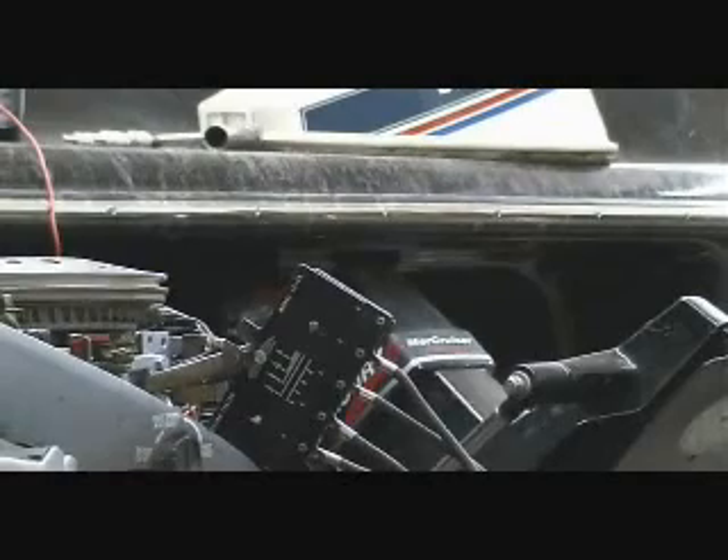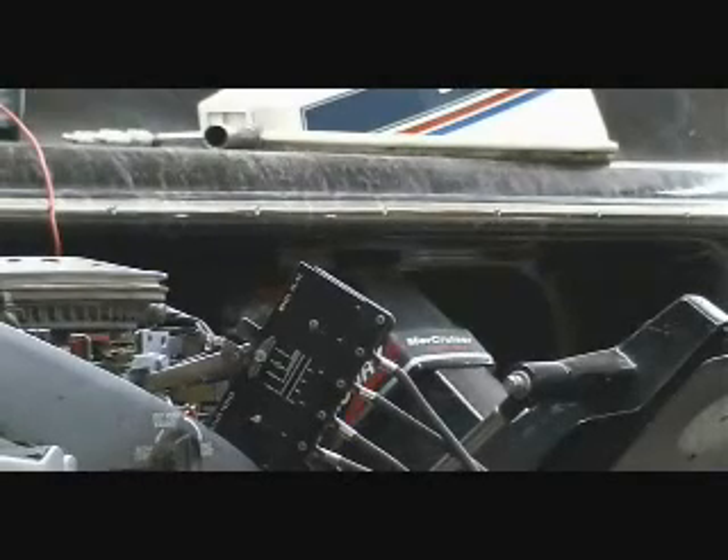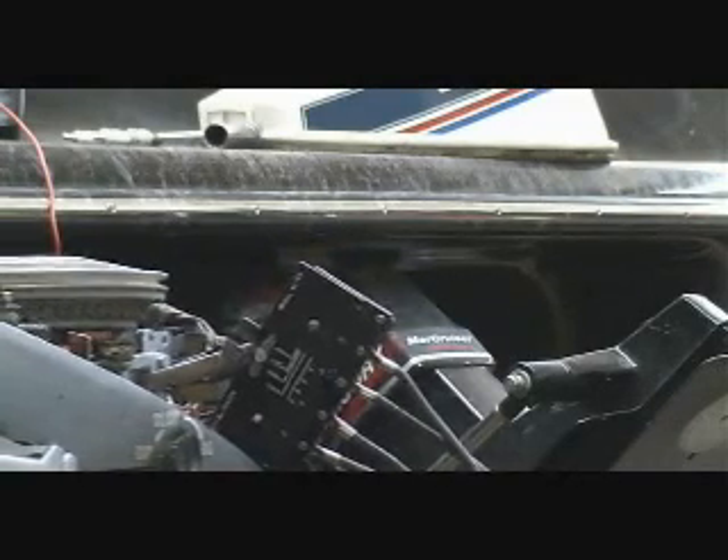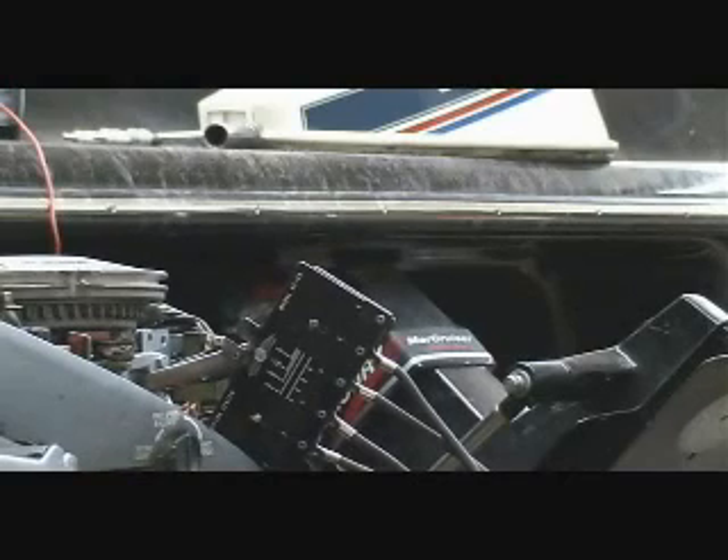When any engine comes in that is apparently down on power — half throttle, quarter throttle, or whatever — whether the customer believes it's a spark-related problem or mechanical, we always check both to start with. Right now, I've got my spark checker hooked up. It's a two-cylinder engine and we've only got spark on one cylinder. Let's find out why.